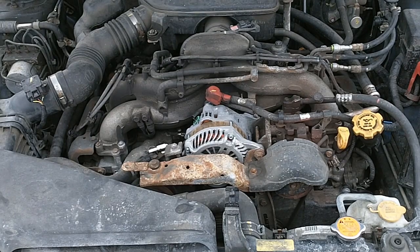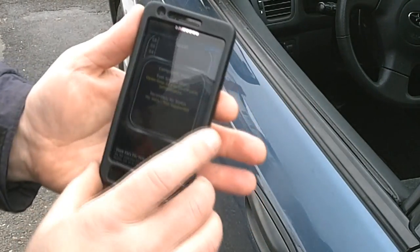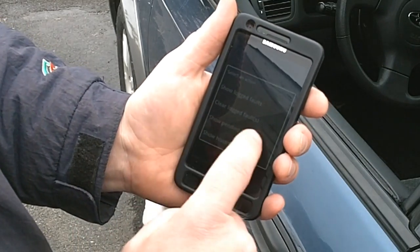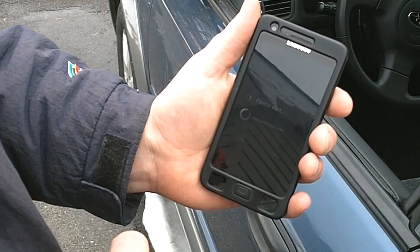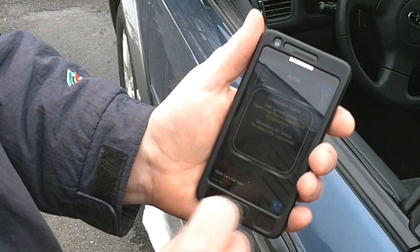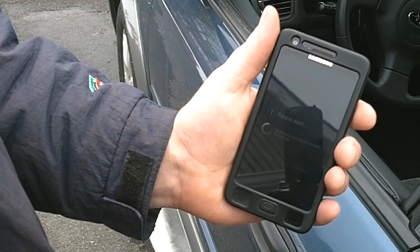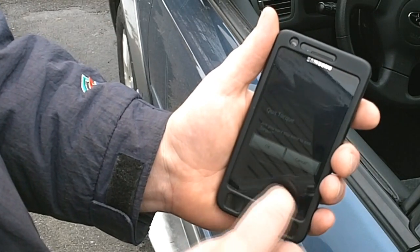The diagnosis continues. I don't know if you can see this or not, but I'm checking my ECU here with a Bluetooth jobby, and I'm getting an open loop due to insufficient temperature. I don't know if that's regular or not. Let me just see what's been logged here on the ECU. I see she's flashing the check engine light again. I would expect a P0302 cylinder number 2 misfire, because that's what I was having before. Yeah, P0302. So that's exactly what it is.